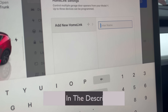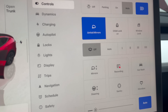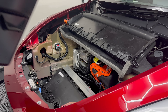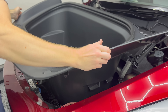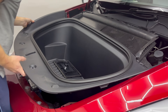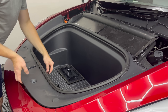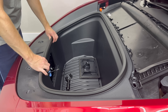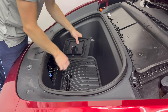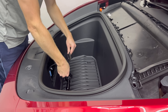Again, the hardest part was that bracket. Now we're going to put the bucket back into place — remember we have that cord in the front for the emergency hood latch button, so pull that through making sure it's in there. Reconnect the cover plate and that should snap back into place.